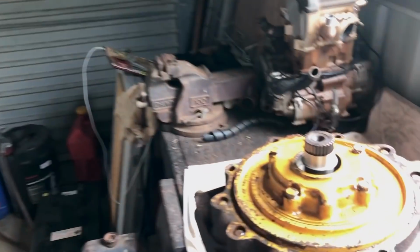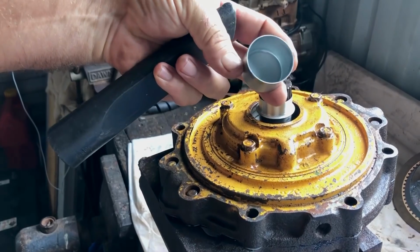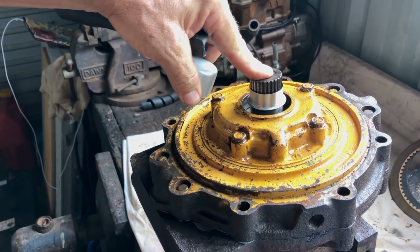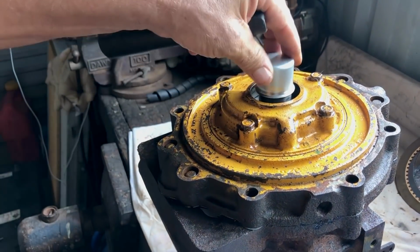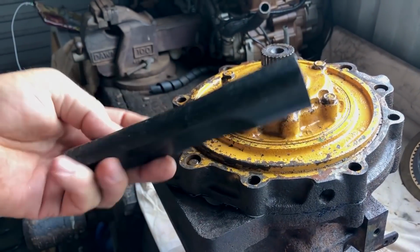What's going on now? Well, the problem was the speedy sleeve fitting. The tool you use to put the speedy sleeve on isn't deep enough, and it hits the end of the shaft. So I've been rummaging around in my workshop to try and find something that I could utilise, a bit of pipe or something. And Wendy said, what about the end of the vacuum cleaner?